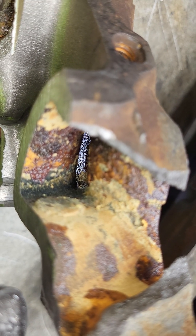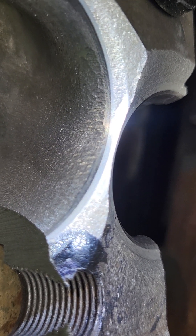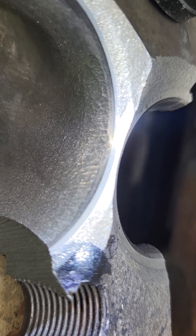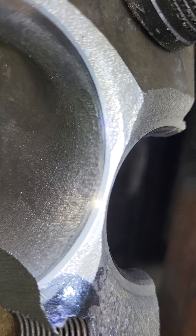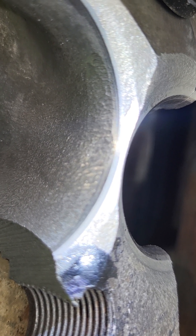A little hard to see, but this is actually the water jacket between the intake and exhaust port — that's why it cracks. That water port goes all the way up to the seat; they should have put more iron right there. You can see this head is cracked — it's a tiny crack, and I don't know if it would leak water or not.